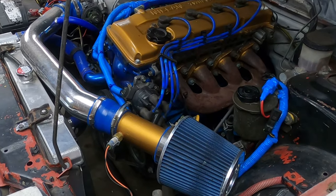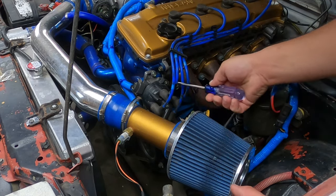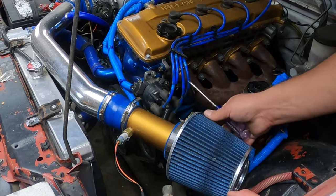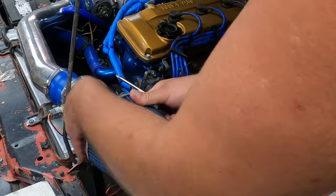So let me get this distributor opened up. I've already made the settings changes in Tuner Studio. So we'll swap out the disc and see if it cranks. And if it does, great, that's more than it would before. Before I couldn't get any RPM sync using the incorrect settings because they're wrong for the wheel. So it's not too hard. Let's see if I can't just scooch this up out of the way.